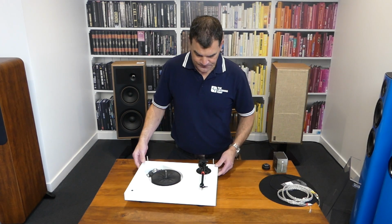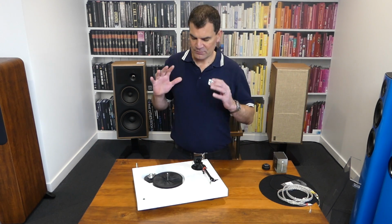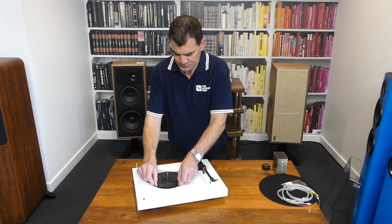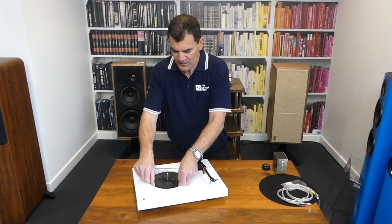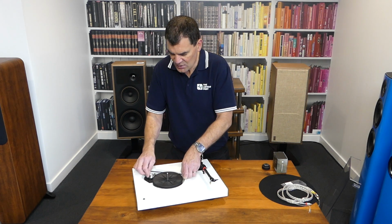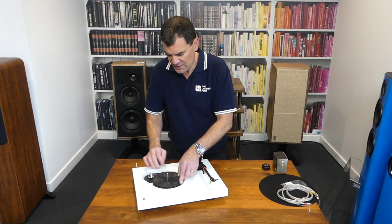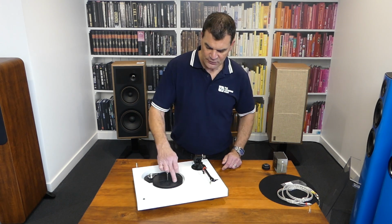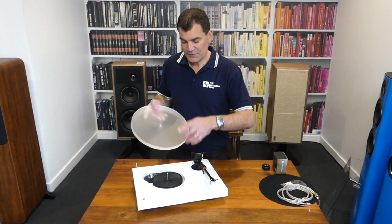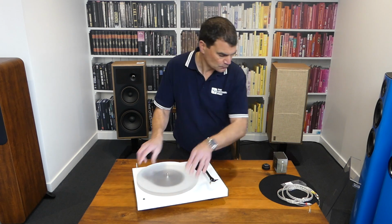its connections. Now, as far as the turntable itself goes, what I want to be able to do is just pause and start assembling it so that you start to see the product looking as it should. The Pro-Ject belt goes over the central pulley wheel, and then over the smaller of the two options for the motor. Give it a quick turn to make sure it's sort of seated correctly, and then add the acrylic platter, again with that recess on the top. Again, this is just a light assemble.